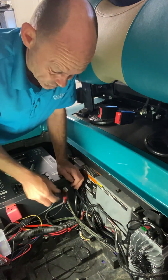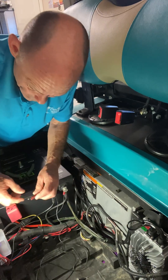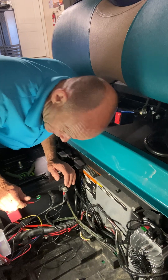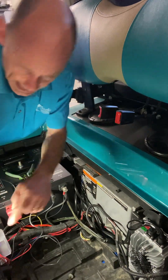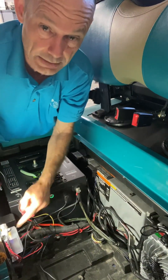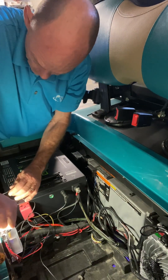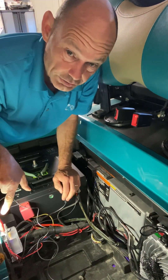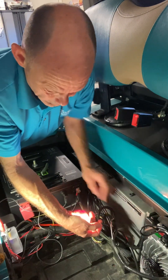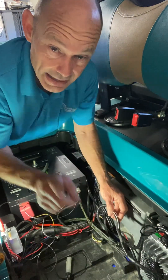I can't switch this lead over to my 48-volt hot because I'll blow out my test light, so let me find a 12-volt out. I've got a fuse block that I put on mine because I've got a whole lot of accessories. I've got my test light hooked on my positive 13 volts — now let's hook it to the ground — the black wire is your ground, absolutely without a shadow of a doubt.